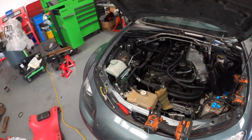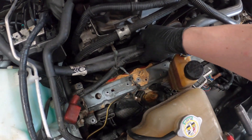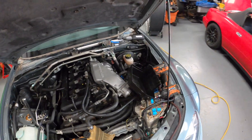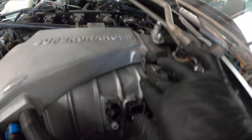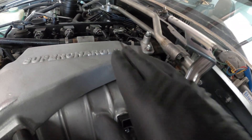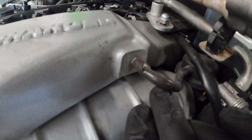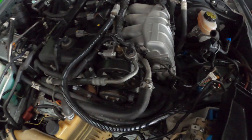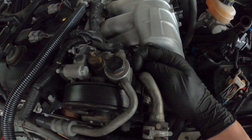Tearing this car down — battery acid spewed all over the place, all over the fan, all over the frame, and it destroyed all the bolts that were on the bracket and the battery base. Then moving over here, that is a concern right there. The shock tower brace is coming across here and it just left this wide open, so it's hard to control your supercharger.